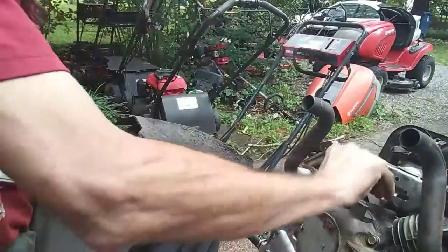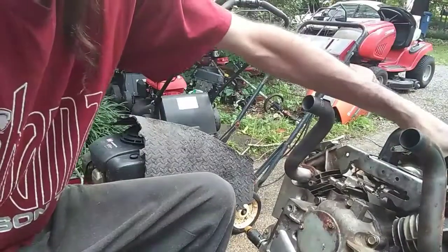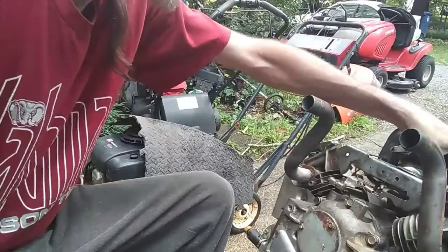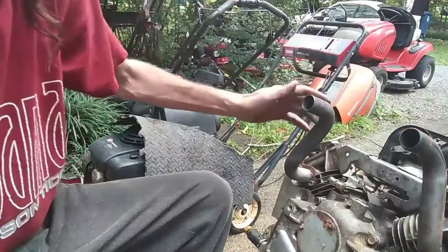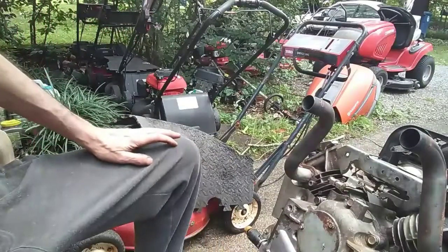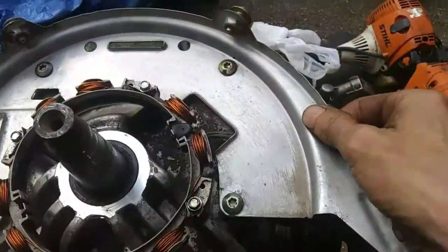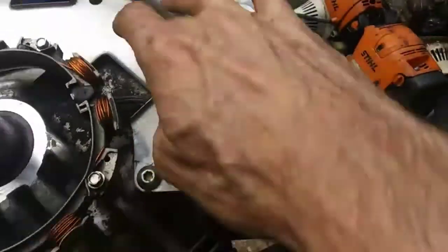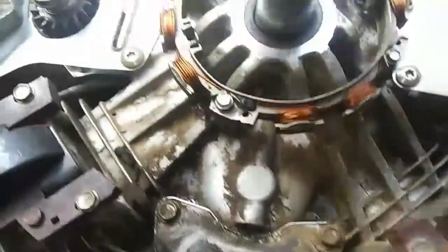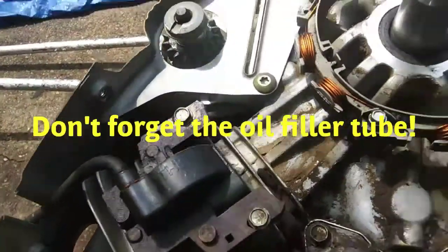All right. So now we got it. Hope you can see that. So it's moving fine, just like that. We got the other muffler pipe on. Now we're going to move on. We're going to flip it back in the bucket. Move to the next part. So the next thing was to get this plate back on. Chrome plate has 4 Torx head T27 bolts that hold it on. Fits underneath the stator, over the starter there, and inside the heat shield guards. Just like that.